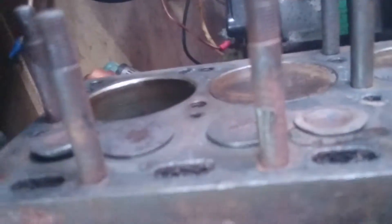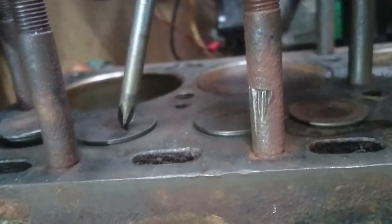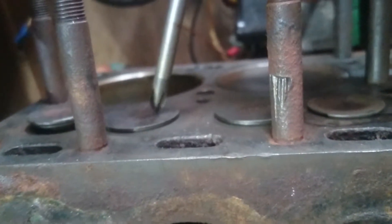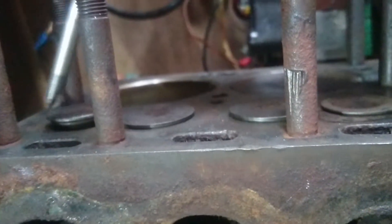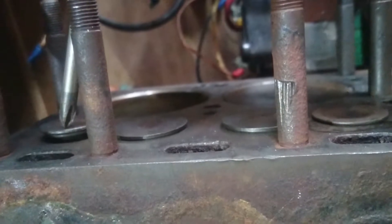You can see up top here, the valve is on the head, which means that the spring is in its resting position. The moment a valve is close to lifting or lifting is where you don't want to set the valve clearance.